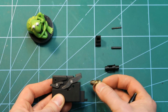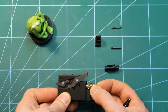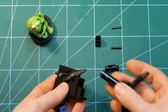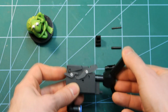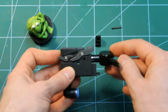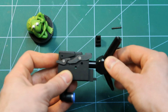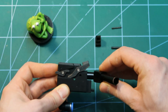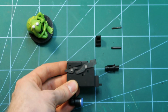Okay, so enough talking, let's just check that all the seals are in place, that they are clean and nice and O-ring like, and we drop in the valve, and then we take a valve wrench and we rotate counterclockwise like we always do until the threads catch, and then we screw it in. Not too tight, not too light, just to be sealed and test it in the field. Okay, so I feel already that I'm compressing the seals, so again I will not overdo it.